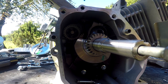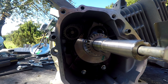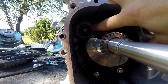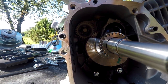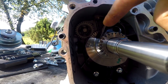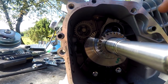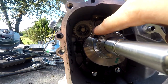You might have to punch it out a little bit depending on how good your cut was - mine wasn't great. There's one out now. Back in here you've got that little plastic gear with the little metal clamps on it. There's a stud behind the flywheel that you can punch out and remove that whole assembly, instead of sitting there having to pick at it trying to get all those little pieces bent or broke. Then you've got to worry about little chunks floating around in your block - make sure you get all of them out.